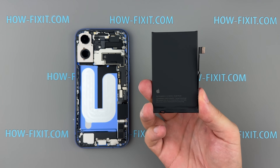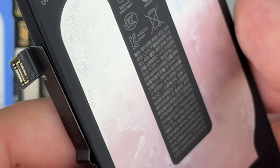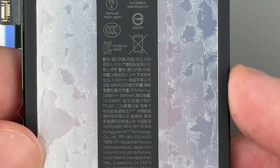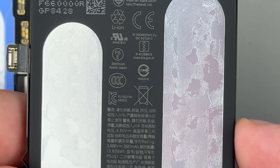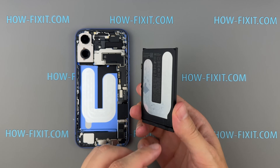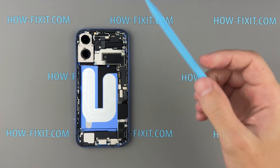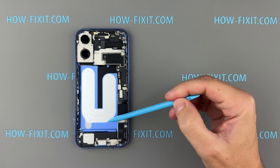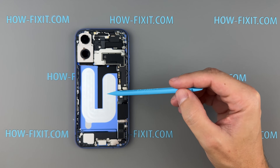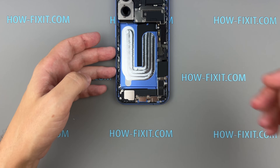And yes, you now need a battery to replace the battery. The iPhone 16's 3561 mAh battery provides up to 22 hours of video playback, which is slightly larger than its predecessor, thanks in part to the power-efficient A18 chip. Apple might use electrically induced adhesive to help improve heat management. By bonding the battery more securely to the chassis, heat generated during charging or heavy use could dissipate more effectively, improving the overall performance and longevity of the battery.